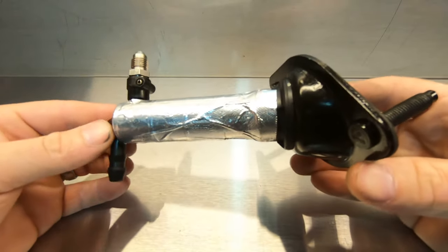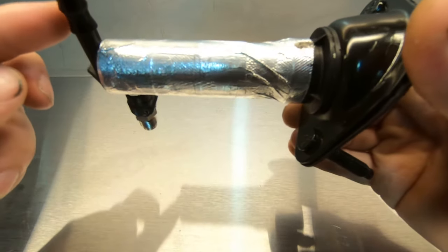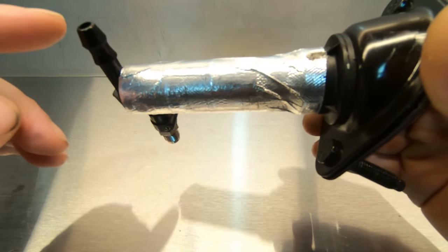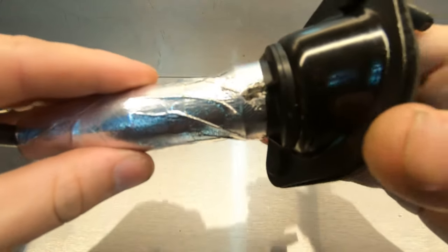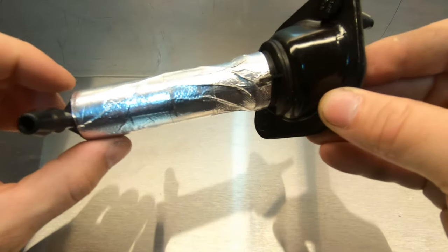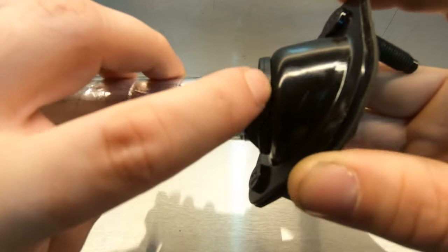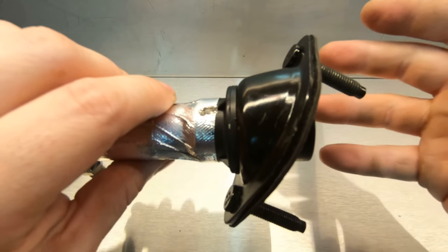Took it back off. I'm looking at it, and it's like, what needs to happen? It's like the index of this — this plane here needed to be clocked, indexed in relation to the plane at which this mount mounts to the firewall. And I'm looking at it, and it looks like it's two pieces there. And I was like, okay, well, maybe I can just spin it. And problem solved. So that's what I tried to do.